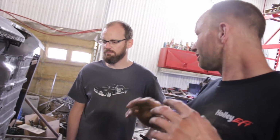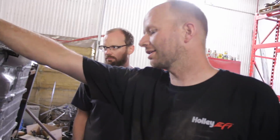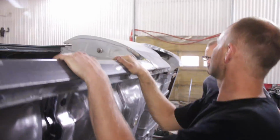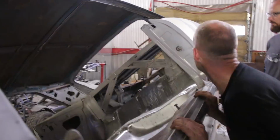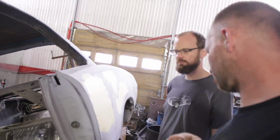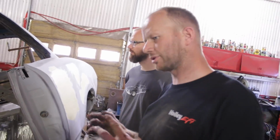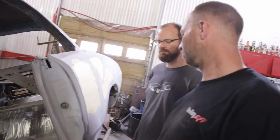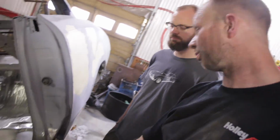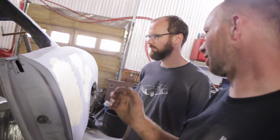Tape off the inside and the outside and the bottom, and then paint a spray putty that we're gonna put on the outside. We've done the initial blocking on it. Just this piece is left on the outside. We'll put a spray putty on it, bring it back, assemble it, start blocking the car as a whole, set up all the lines, and then we gotta bring it back and forth. Hopefully only 1 or 2 more times. We gotta tape off the whole bottom, and then epoxy the whole thing, block it, epoxy it, block it, and then it'll be ready for paint.